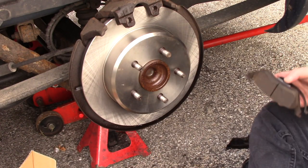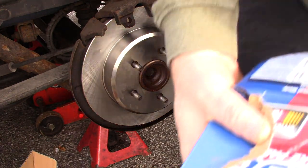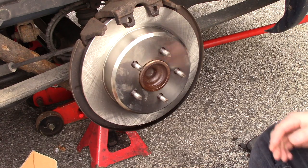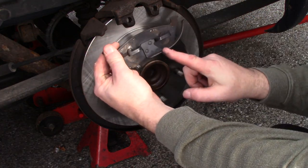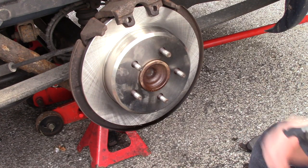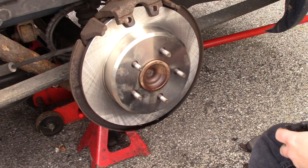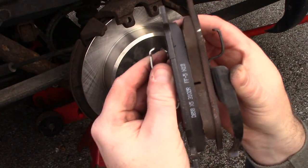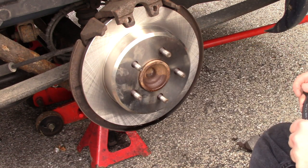Now is a good time to replace your pads. These are actually still good, but we're going to replace them anyway. I have a habit of buying brakes too many times, so these are actually opened. These are MKD 858s — they are the rears for the van. The important thing to notice when you do your brakes, if you're doing both sides, don't get confused. Keep the orientation of this brake pad because it has this funky little clip thing. Make sure it's the same orientation. Usually the tab goes towards the back. Comparing them to the original pads, you can tell they are pretty much the same thickness.